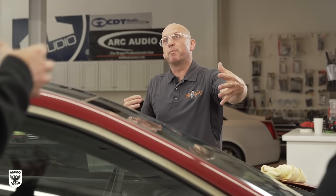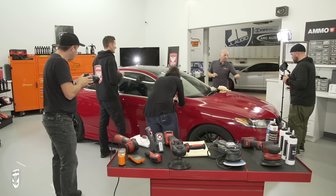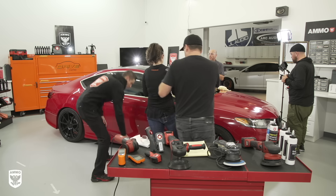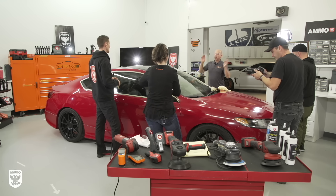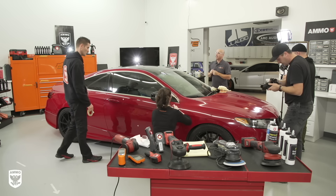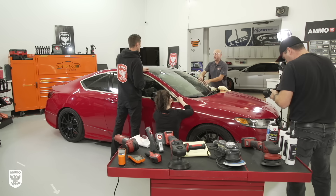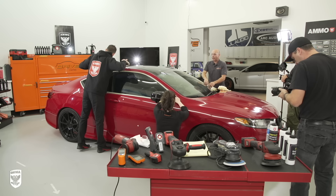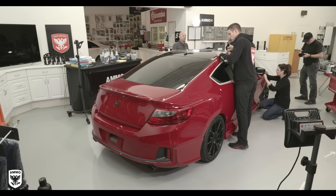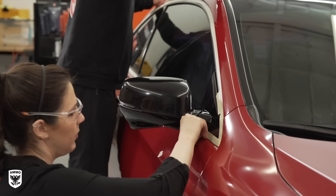In the factory, a release agent lets them pull the bumper out of the mold. That solvent would leach into the bumper structure, and when reheated for painting, it would sweat out — causing fish-eyeing and adhesion failure. They'd heat it to a specific temp, panel-wipe, let it flash, then paint. The same thing can happen with polishing: you hit that temperature, adhesion fails, and the paint tears off. So with bumpers or any plastic today, I do a couple passes, wait, move, come back — never letting the heat or friction build up to that grabbing point.